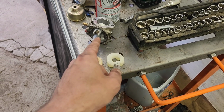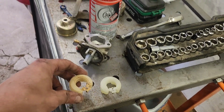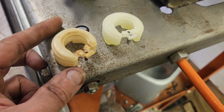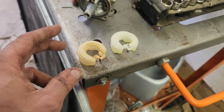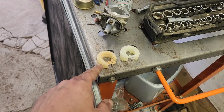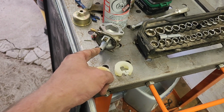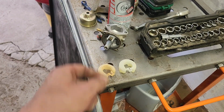This is what came out of that Kawasaki carburetor. This is what came out of an actual GX200 carburetor. They're both exactly the same float. No differences whatsoever, exact same size, needle mics out exactly the same. That retails for 4 times the cost of that. Pay attention when you're dealing with this kind of stuff. A lot of times things are swappable. In fact, I'm pretty sure the jet that's in here is just a regular standard jet like a Honda GX200 uses.